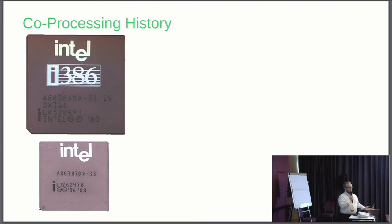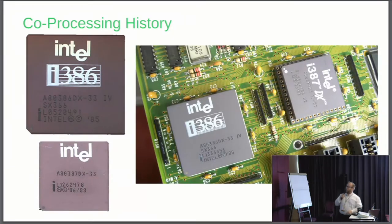It does floating point way faster than the main processor did. You'd have to get a motherboard that looked a little bit like this — a bigger board, more power. But for those who had it back in the day and needed to do floating point operations, with programs compiled with the compiler flag turned on to include that instruction set, you're getting much better execution than those who didn't have that. I didn't have one when they came out, but my dad helped me find one out of the dumpster, so it was a great option while my sisters were playing on the 486 DX.